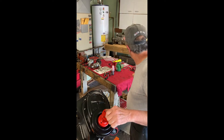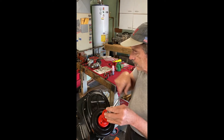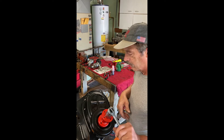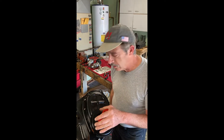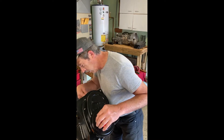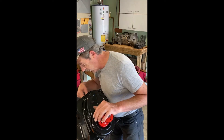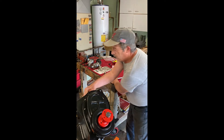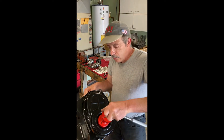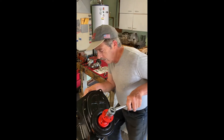It is at top dead center, so tighten this down a little. Now the question is, are we on top dead center on the power stroke or the exhaust stroke? I have a lifter - I'm going to put in two lifters. Now with my fingers on the lifter, I can rotate the crank and I'll know where the valves are. Let's give this a shot here.